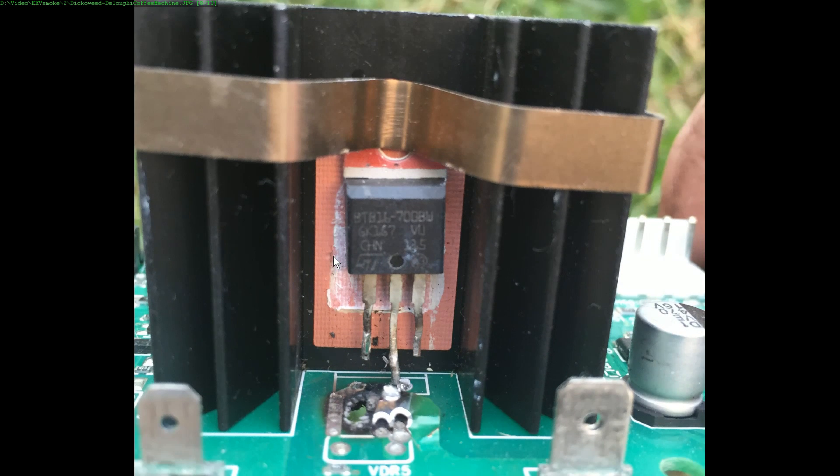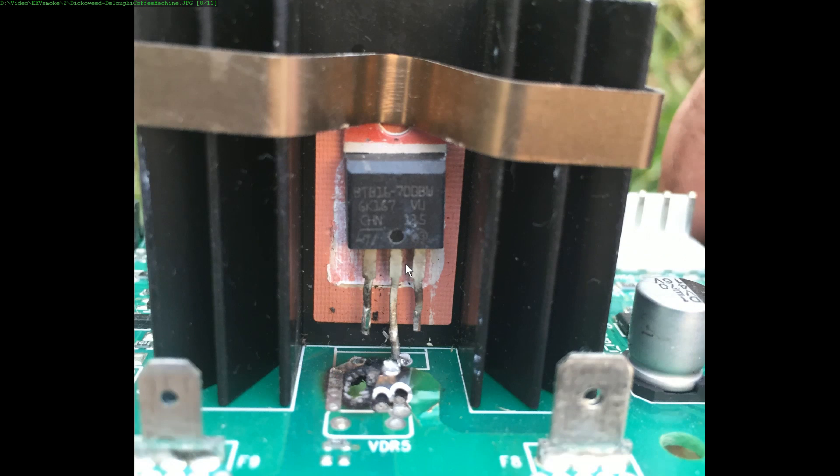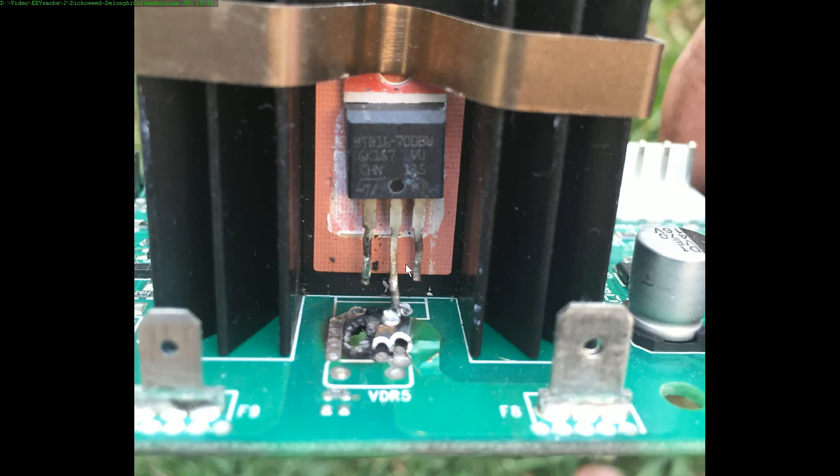In this case it came from a DeLonghi coffee machine. You might think, well what happened to it? Well — that is what you think it is — it's a cockroach! Absolutely fried itself while the thing was actually on, and wham — the magic smoke released from not only the triac but from that poor cockroach as well. Anyone used to repairing stuff or taking apart old equipment knows it's very common to find failures like this — these creatures like the warmth of the equipment, so they crawl inside and end up bridging the wrong tracks. And yep, that's what happens!